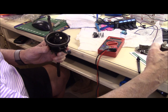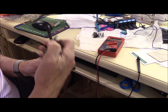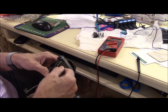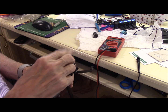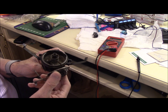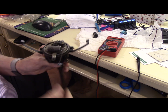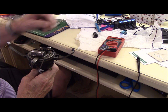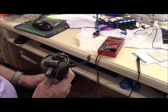I'll show you where that lower plate goes on. This is the lower plate, and it's held on with two screws. Then the spring goes on. Then the upper plate goes on, and you hope you don't let that little black wire touch anything that'll cut it. Then you put this piece on, and then the cam goes on, and you time it and you're off and running.